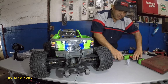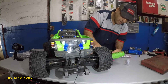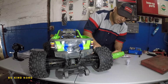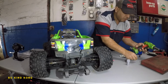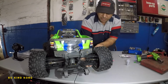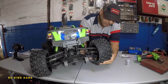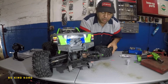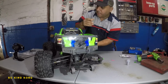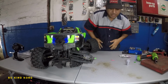So what we're gonna do is we're gonna take off this wheel. So it's very simple. I use my drill bit here, 17 millimeters, and the nut comes off. Then you're gonna take the wheel off. It's very simple to change out bearings on the XMAXX. But it is, whoa, like I told you, they're maintained well, but they can be dirty. I already said that to begin with.